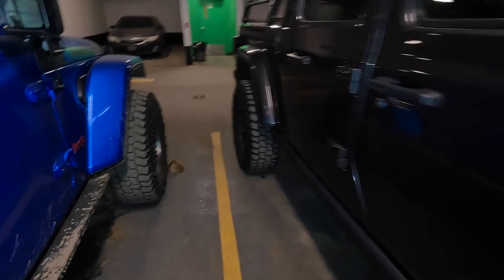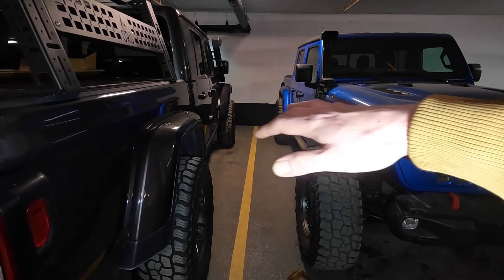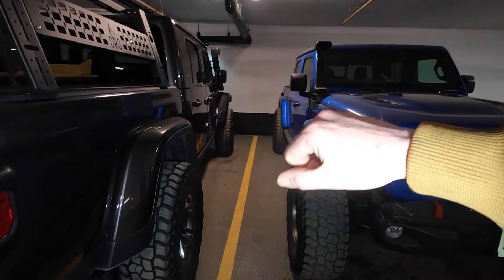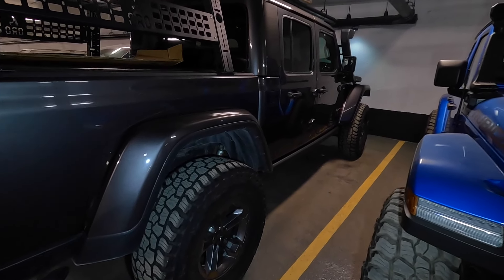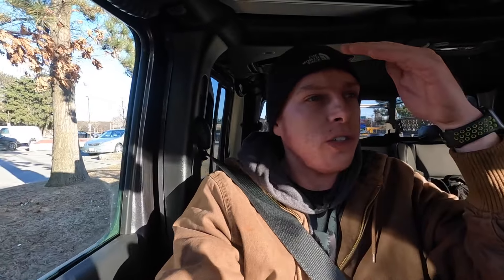I've checked mine and don't have any issues yet — you can see them in there. The way Sean described the worn bushing feeling is sort of a floaty sensation, like when people say it drives like a boat. It doesn't have that direct steering feel. With the new Johnny joints that should make a big difference. Just driving it out of the garage Sean's already saying the steering feels a little tighter.